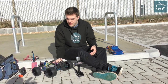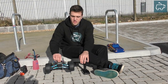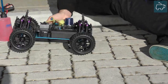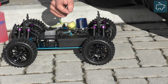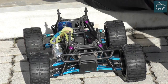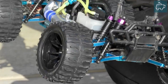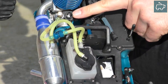Turn on your receiver and check as usual that the steering directions are correct — left is left and right is right — and check the throttle movements as well, making sure the carburetor is opening and closing correctly. Next, check that we've got a throttle opening gap of 1mm. This one's actually a little bit high, so I'm going to adjust that — this is your carburetor opening gap just in here.